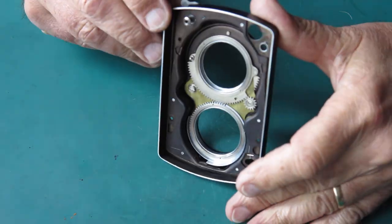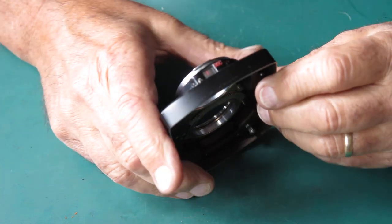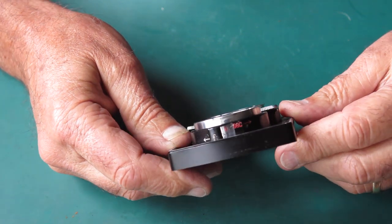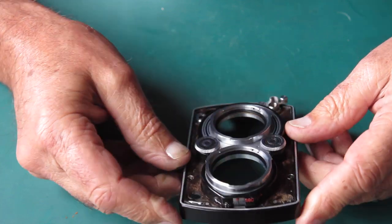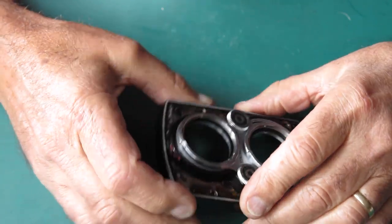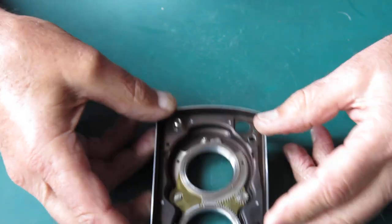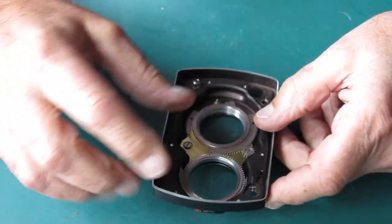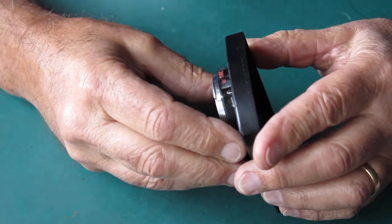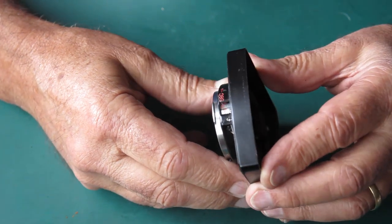I've got all that back together — I didn't show you the process of putting it back together because it took me an age — but I'm going to tell you the principles involved so it'll get you somewhere down the track. You can see the window here is nice and clean now; you can hardly tell there's a piece of glass there at all. It just needed a very light wipe with glass cleaner. Basically there are two layers here. The bottom layer — these are the pieces on the inside with our scales — we've got our shutter speed dial, which needs to revolve from B to 1/500th. It's coupled to this wheel down the bottom.